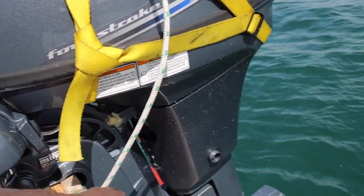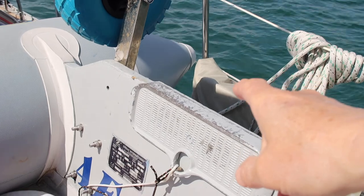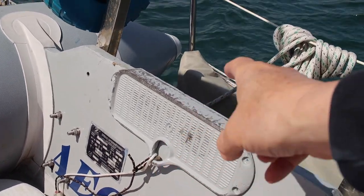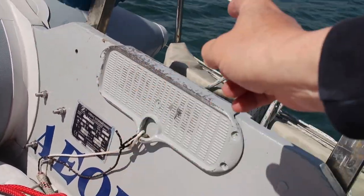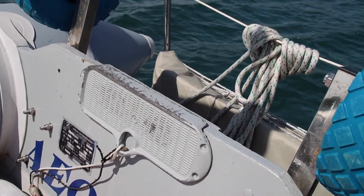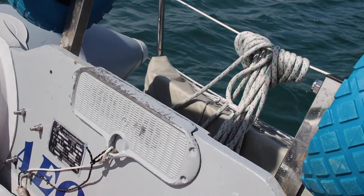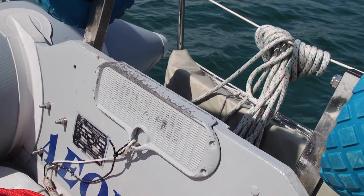It's probably slightly short between the prop and the top of the transom mount. So when it goes on the transom of the dinghy, it might be slightly too high. You may need to actually trim the transom slightly to get the engine deep enough in the water.